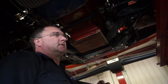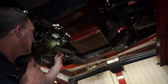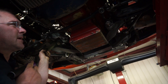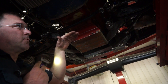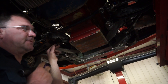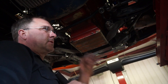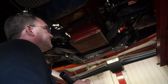A lot of what I do when looking at a race car is figuring out what needs adjusted. In this case, you can see this torsion bar is buried, and this torsion bar adjustment is three-quarters of an inch to an inch different from the other side. That means I'm going to have more spring force on that side, so when the car lifts, your spring pressures are different. I'm going to set these to an even amount and then set my ride height, because different spring rates due to different torsion bar preloads will make the car do funny things when you hit the gas and go straight down the track.